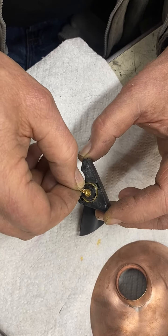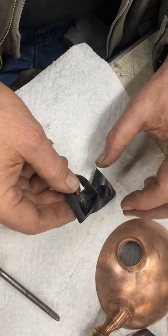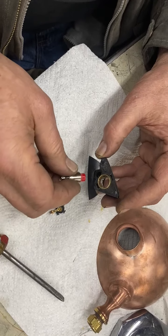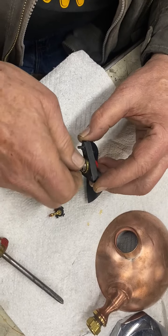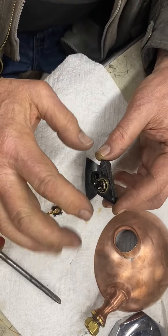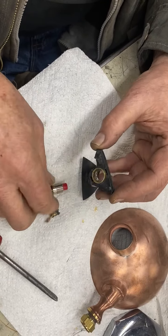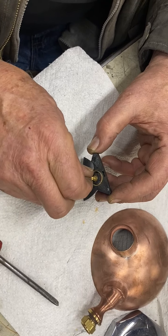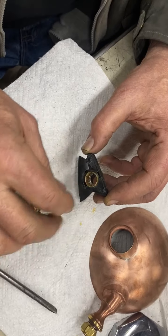As you can see by this contact right here, which is part of the original horn switch arrangement, unfortunately the walls of the original push button switch were too weak and they break all the time. So we're trying to do a retro repair here. We put in this threaded collared sleeve. This bronze sleeve that we pressed in here was part of our original prototyping.